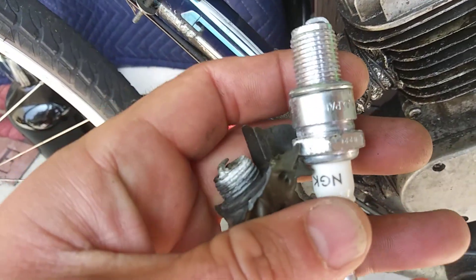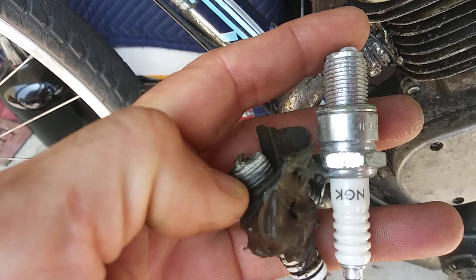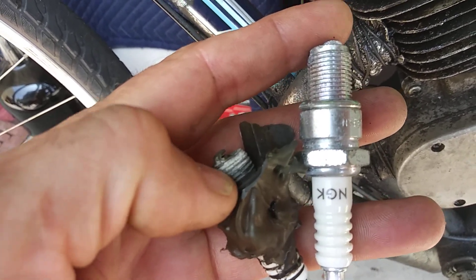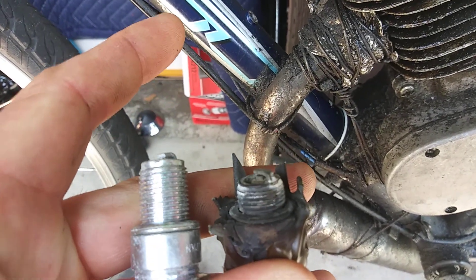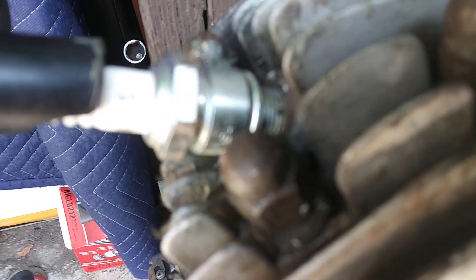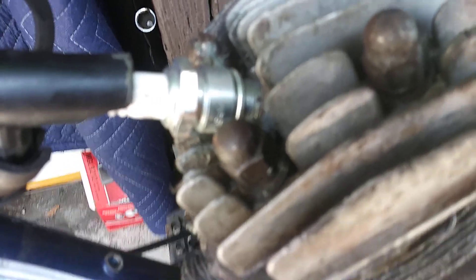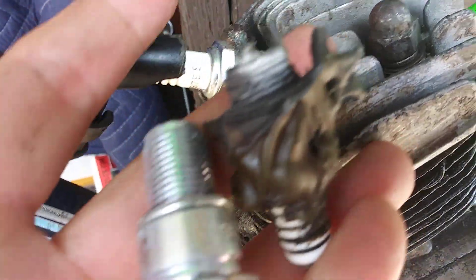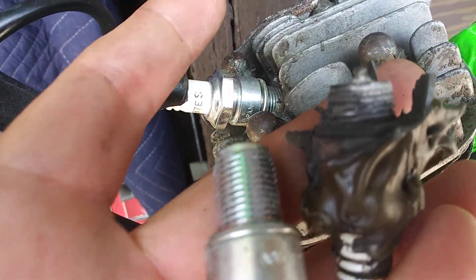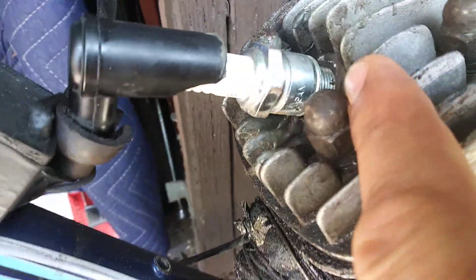Look at the difference in the head length. The original one I was running is shorter than stock, so it gives you less compression. This one is obviously longer than stock — about 30% longer — so I threaded it in as far as I could until it started to get really tight. I didn't want to cross-thread it. It seems to have good compression. It's far in there compared to the other one, but still not as far as stock, so I'm still getting less compression and there's probably some leak since the compression fitting isn't fully compressed.